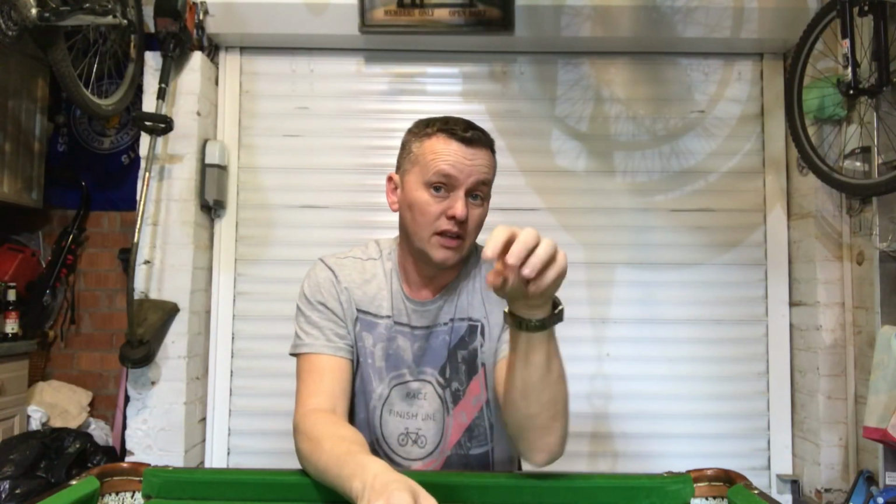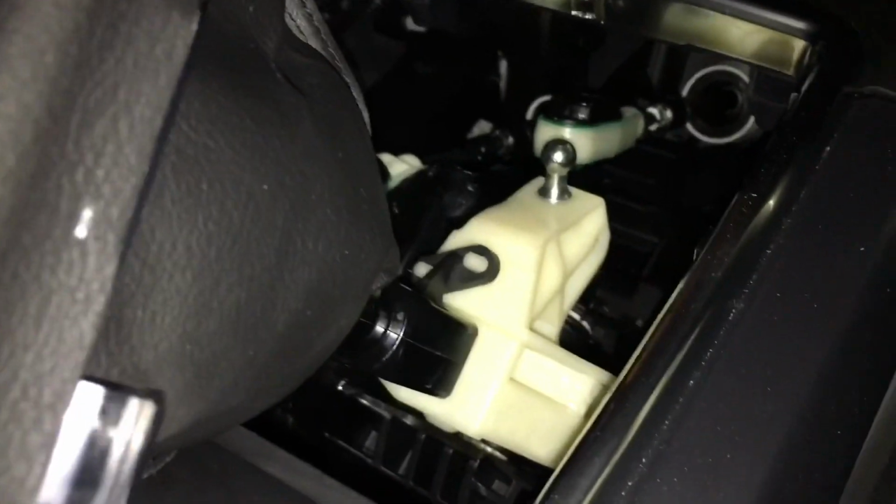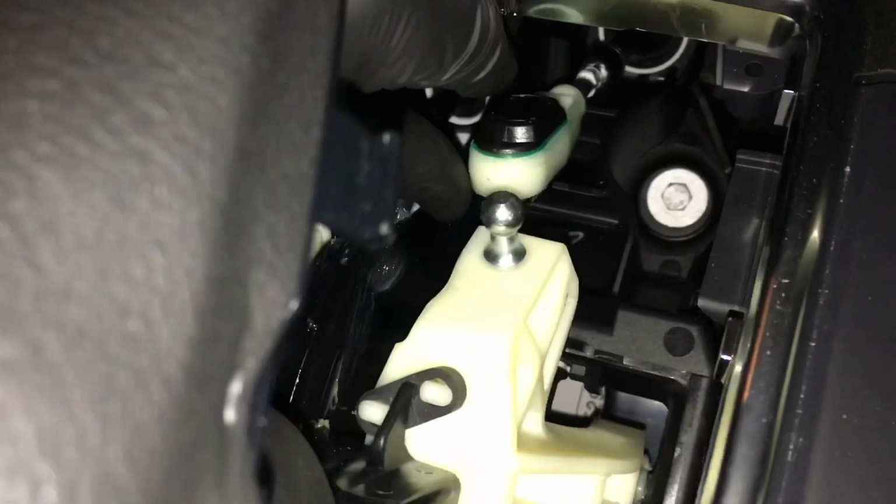Work your way around and just lift it so you can see what's going on underneath, which then reveals the gear selector linkage. Now, as you can see, the front rod has popped off. There it is. Look, you can see the little knuckle ball on top of that lever with nothing on it, and the cable attachment is just there floating away. Just there, look, there it is.